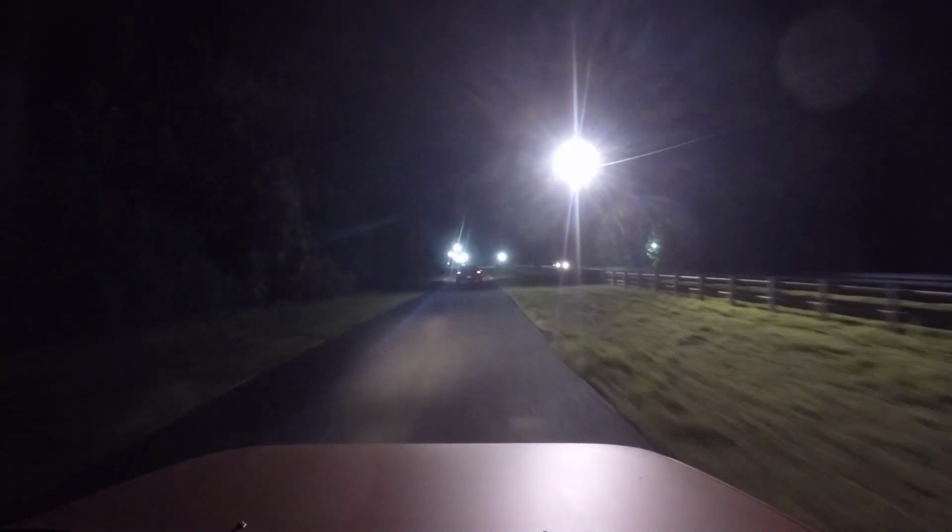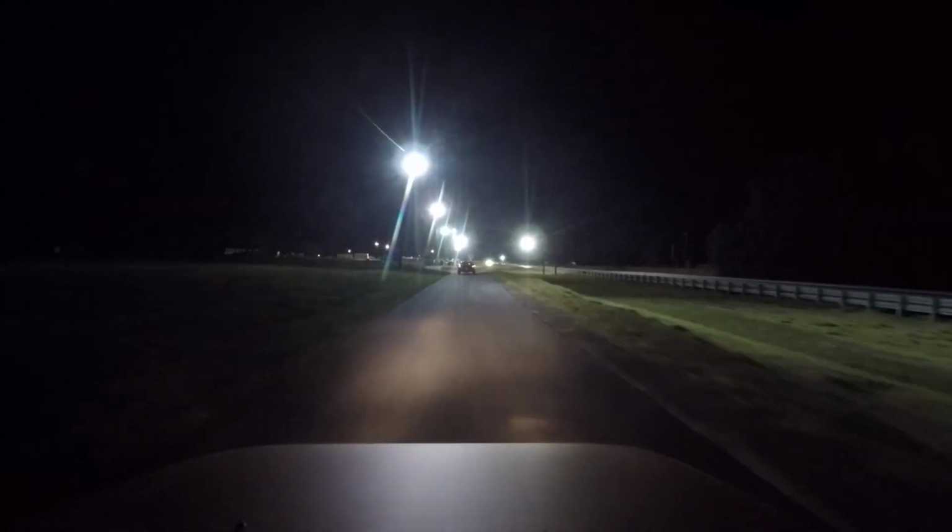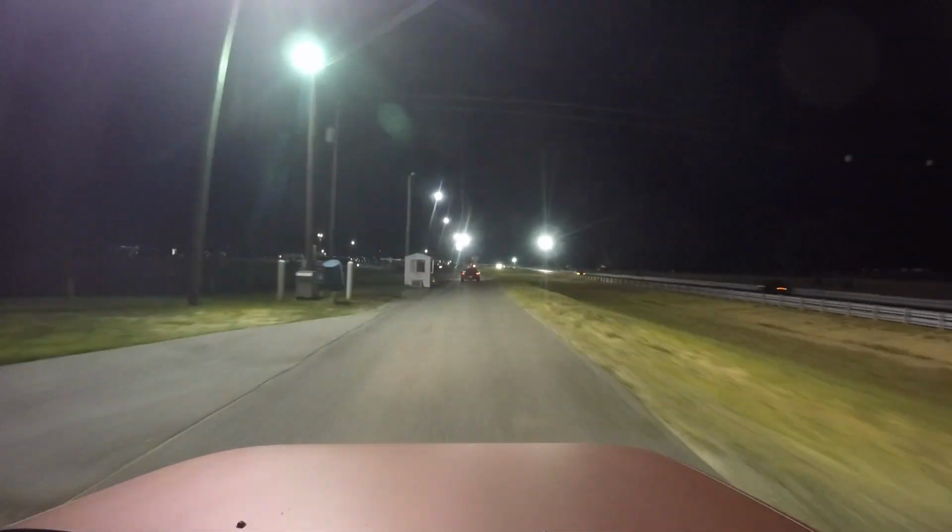It has no problem holding 27 psi. These injectors are doing just fine with this setup. I'm not even above 80% duty cycle. I'll need to make some adjustments to my boost levels and pull a little fuel out, but we're out of time. Staging lanes are closed, and I'm gonna go home and get some sleep. I'm glad I got these logs in before leaving for the shootout though.